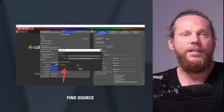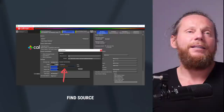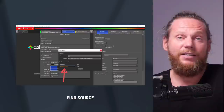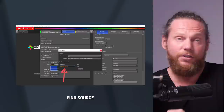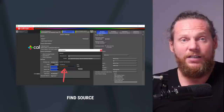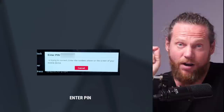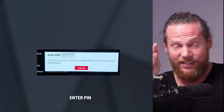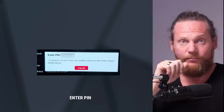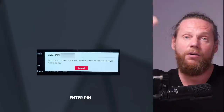The next step: connect your monitor to your Wi-Fi and note your IP address. Then connect your laptop to the same Wi-Fi network. Open Calman — there are three tabs: connect the probe, connect the source (meaning the pattern generator), and then enter the IP address of your TV. When you search and it finds it, the TV will show a message saying 'Enter PIN.' You enter that PIN in Calman, which establishes the connection between your laptop running Calman and your TV.